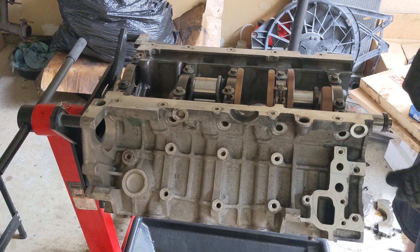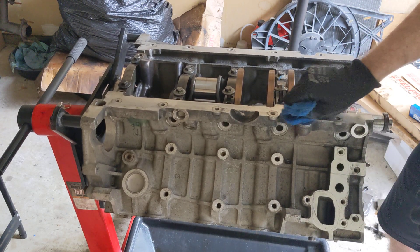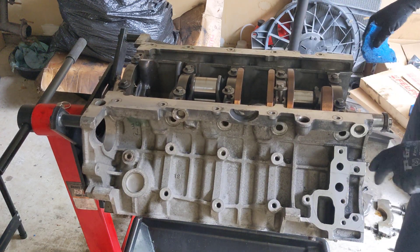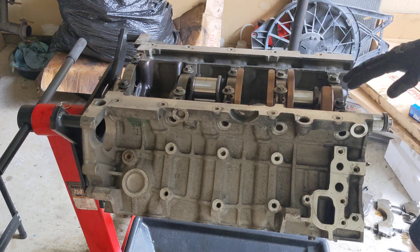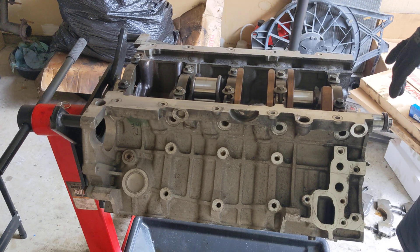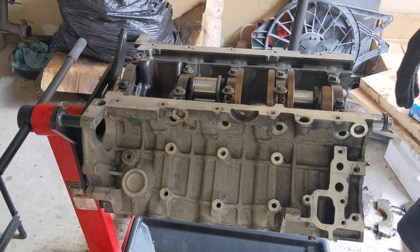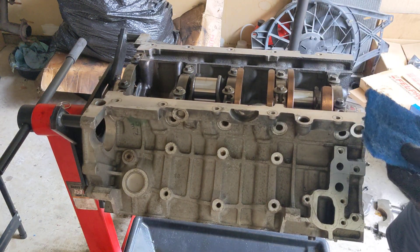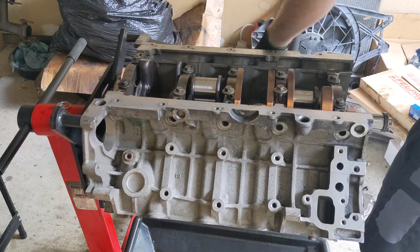Timing components — I clean up the timing covers, and then they go on while the engine's sitting here. It's the exact reverse of what we've been doing. And they don't need to clean up now because I've been doing that. Fucking sucks. Because: bearings in, bolts in, torque sequence, torque sequence — clean the pistons, put them in, torque them all down, and then drop the heads on. Does this thing have dowels? It does have its dowels. Drop them on, head bolt in to hold it down — and it was done. It was basically done. I actually could have this engine done right now in probably a couple hours, and it's only like four o'clock right now. So I'm a little pissed.